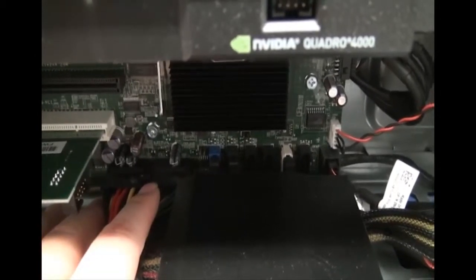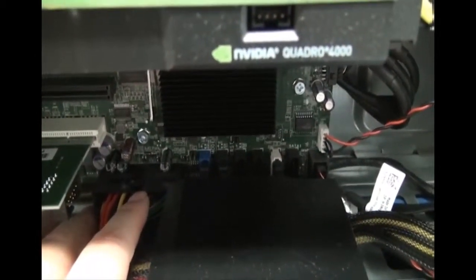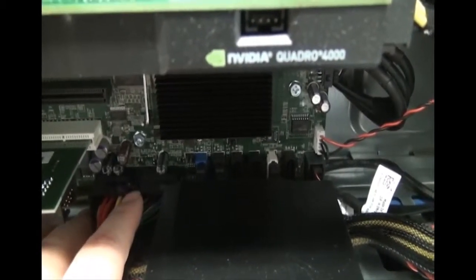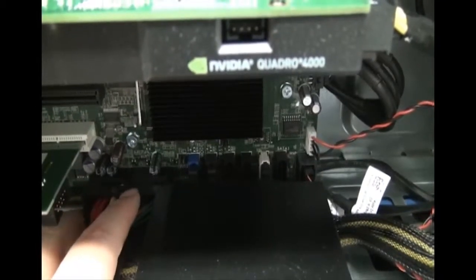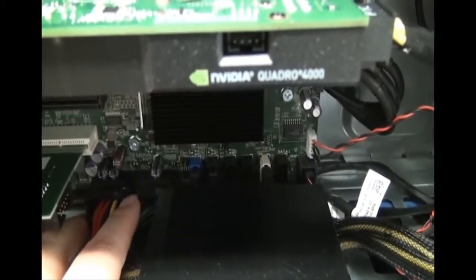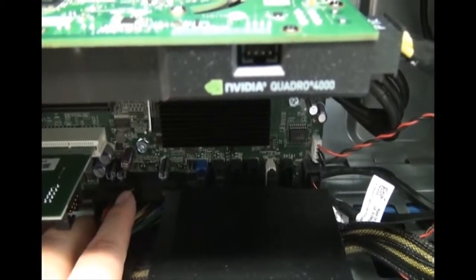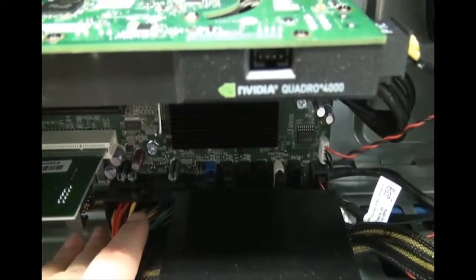The motherboard requires power to feed all of its components. Sometimes during shipping or transit, like driving it home or taking it to campus, this thing can come unplugged, can come loose, and may need to be plugged in all the way. Sometimes when you call Dell and during troubleshooting, they'll ask you to reseat the power connector to the motherboard, and this is what they're talking about.